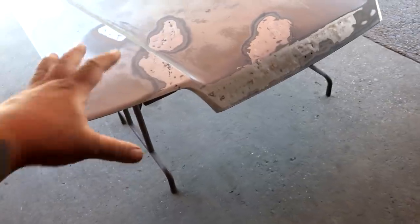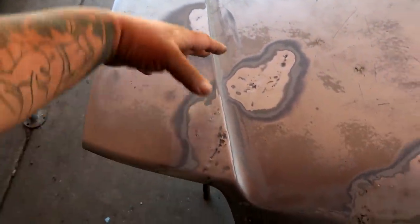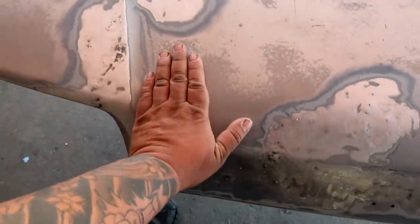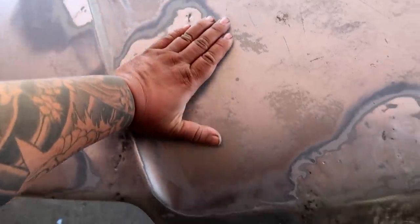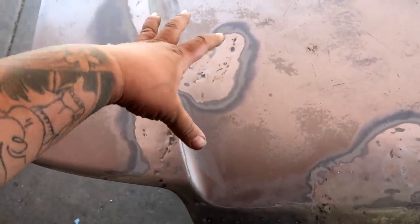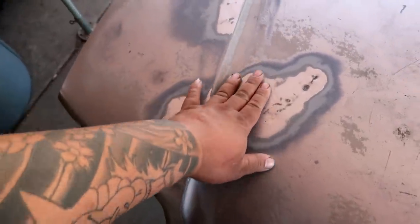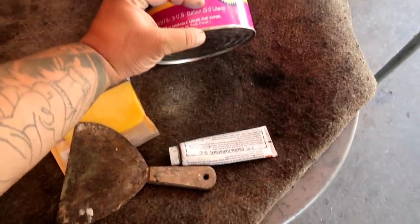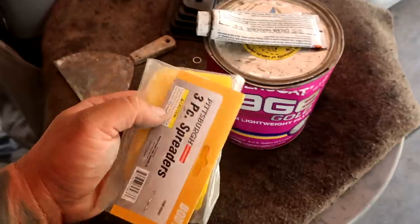It's a new day and today we're going to lay down some body filler. I massaged a lot of these areas yesterday to ensure most of the high spots are not high anymore and it's looking really good. This one took a lot of beating because it was a giant hump and I didn't know how to knock it down and make it stay flat. It feels pretty flat now other than filling the valley — the low spot — which is okay. You can fill in the low spot as long as it's not a glob of Bondo. I tried my best to pull out most of the metal. I got some old Rage Gold and some hardener, plus spreaders from Harbor Freight, and I'm going to mix my filler.